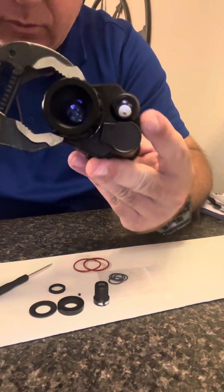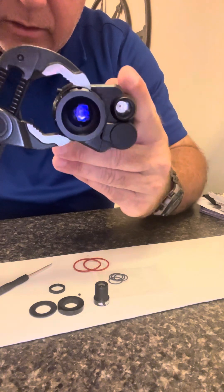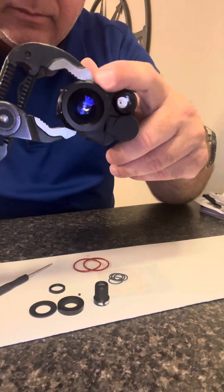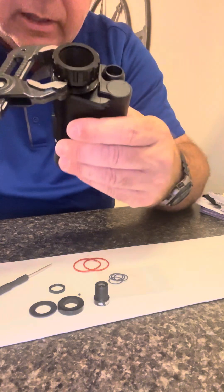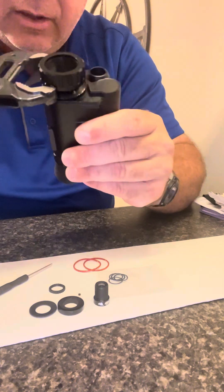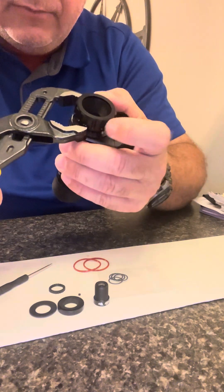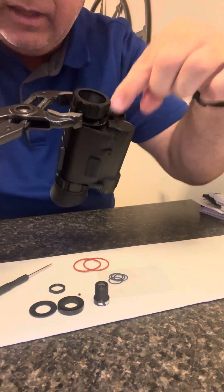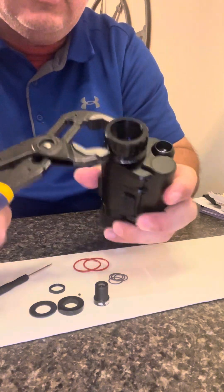Go to about 12 o'clock — maybe a little shy of 12 and 6 — angled back so you don't engage the lens itself but actually hit the module, which is below the lens, not the body. That module will actually turn. You can see because of the scarring on the bottom how the module moves with the lens, and you can see how the lens itself is independent of the module. Watch the lens move but not the module. All right, so you're going to do that counterclockwise and unscrew this lens module.